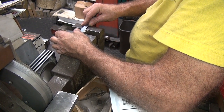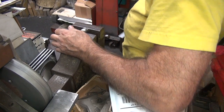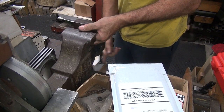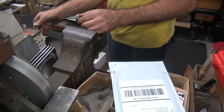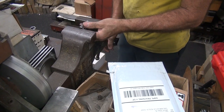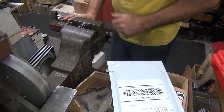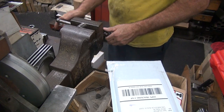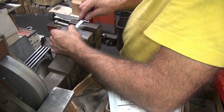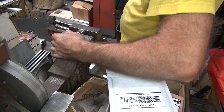We're at 840. So if we call it 50 thou clearance, that would be 900. Plus our lift — what was our lift? 410. So what's 900 plus 410? That's 1,310. This one's about 850, so I think our 900 is a good number. 1.310 install height is what we need, minimum. That's how we pack them all the way up.